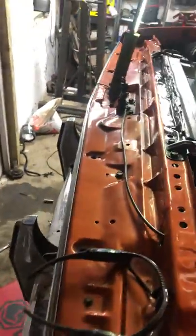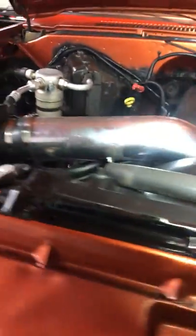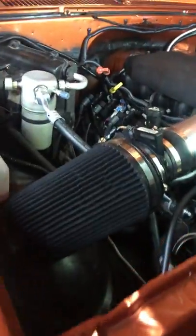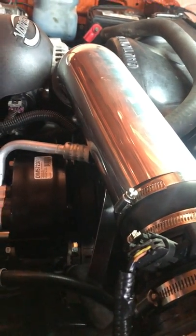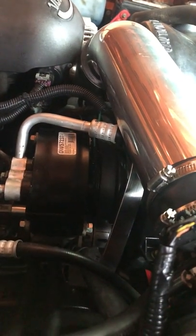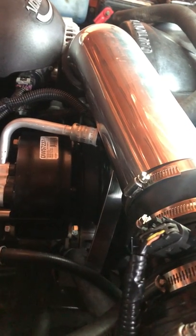The swap is not that difficult. I did this in about two weeks by myself with no help and didn't have any trouble. I do like the LS1 brackets AC adapter; however, I did have to shim the tensioner pulley out just by putting a washer behind it.